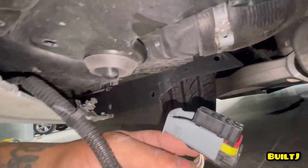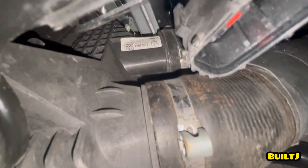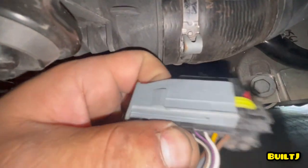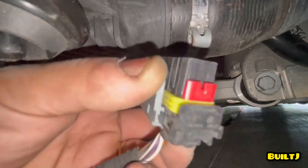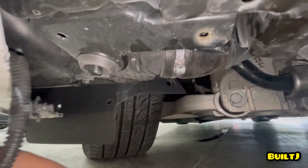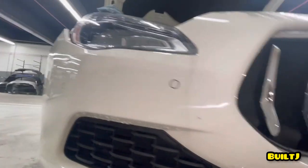All the sensors plug up here. There's a clip right here that is a pain to deal with — it goes underneath and here's the other side that this plugs into. I was able to finagle it out for a little more room. Basically this closes, so you want to pull it all the way out and then you should be able to remove this plug. There is a grommet — you can see that yellow grommet around there — so you may have to wiggle it back and forth until you pop it out. Be careful not to pull too much on the wiring; hold on here while pulling on that side. Once you disconnect this, that's all the electricity to the bumper — the sensors are all over the place — so make sure they'll still function after you remove the bumper.